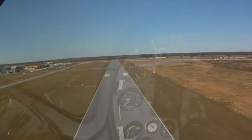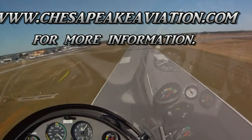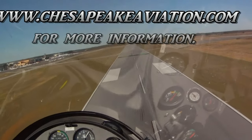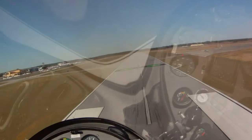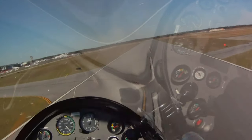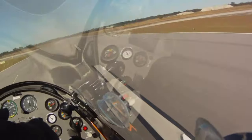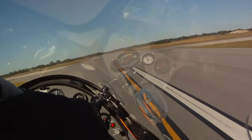We came up and just sort of parked and stopped. If we rolled 50 feet I'd be surprised — that was just not very far at all. A very compact landing in the hands of an accomplished pilot like Bob Snyder. Once we got down and shut down, there's a process — there's a control on the instrument panel that says flight or brake. A braking action can occur, described as something like a bicycle brake pad that presses up against the same starter disc that pre-rotates the rotor disc, which begins to slow the overhead blade down.